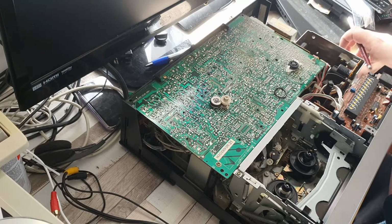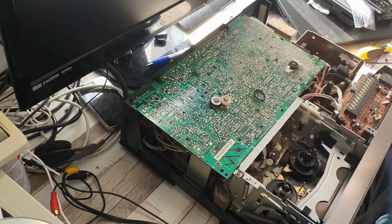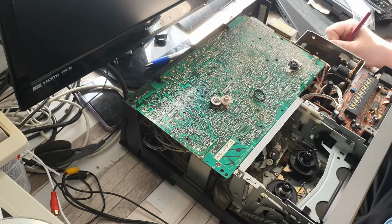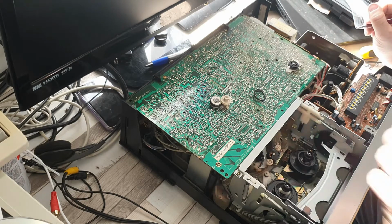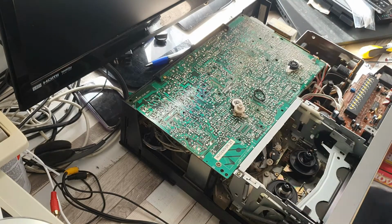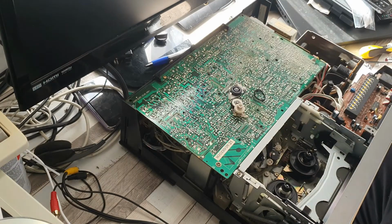Certainly seems to. So we're going to start off with this small belt. This will be suitable for the VTC M20. The 5000s and 6500s didn't use this dual idler assembly. The earlier ones actually had a cogged assembly, but the later decks, so I think the NX100s or the NX10s or whatever they are, the M10s, M20s, M30s, all use this sort of dual idler setup. So that is what we're going to be focusing on in this video.